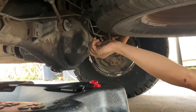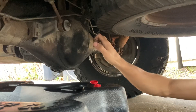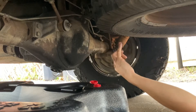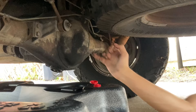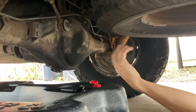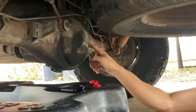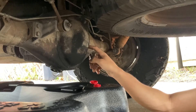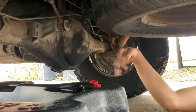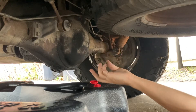Before you pull it off — this is just the fill bolt, it's not going to drain from here. You can actually gauge how much differential oil is in by sticking your finger in it. Not much. Maybe that's what made that wet spot on the bottom. This is definitely in need of it. Usually five millimeters under the bottom side of the bolt is where the fluid level should be. I'm reaching in there like an inch and there's nothing. And there are metal shavings too, so that's not great.